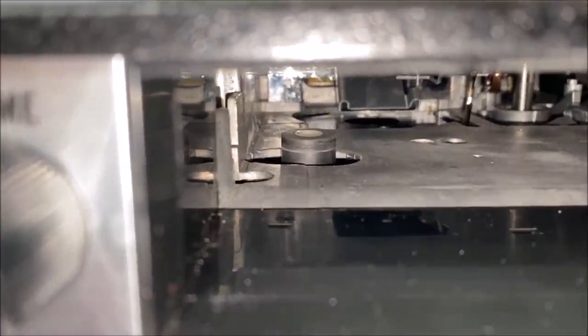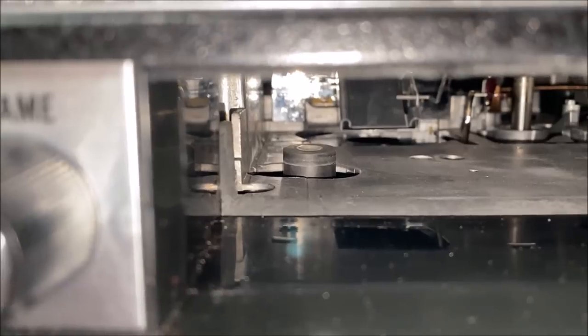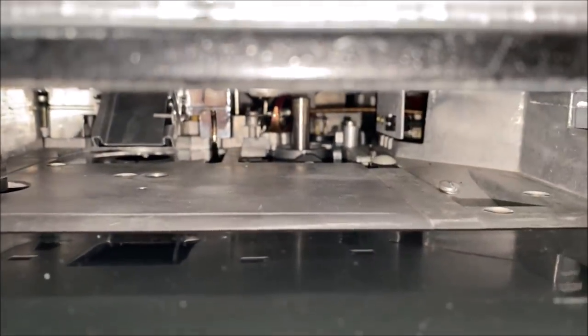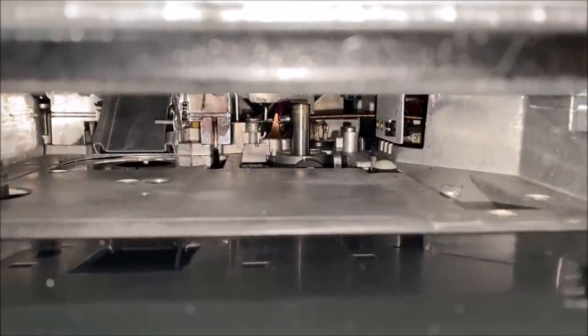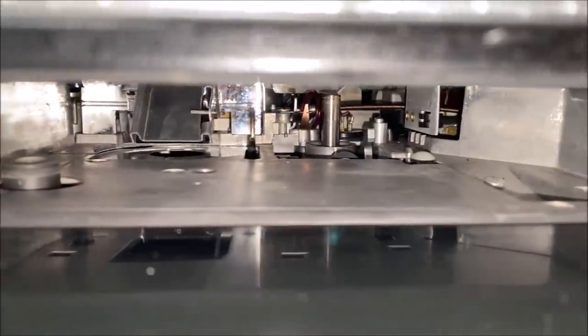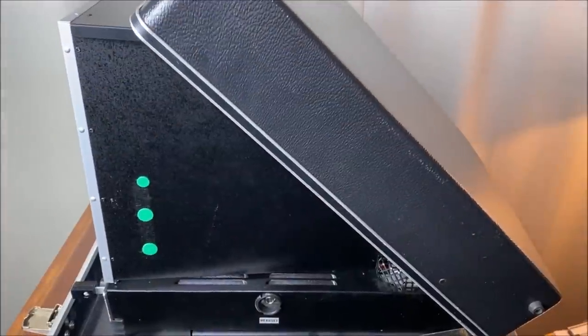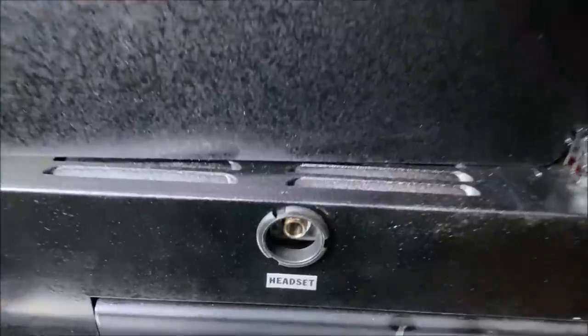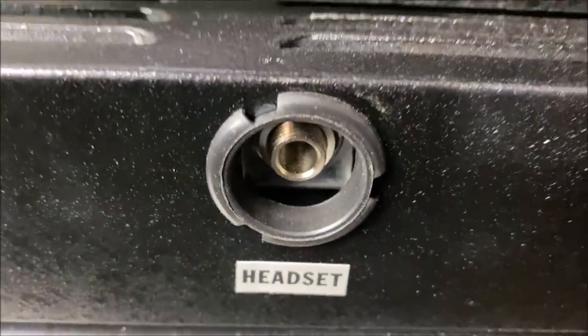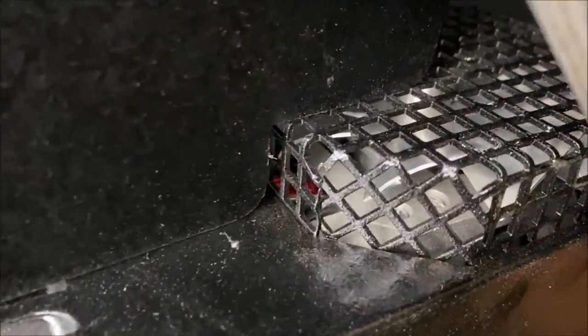There's a roller here on the left — I replaced it with an 8-track tape roller because the original one was goo. In the center you'll see the capstan that meets the pinch roller, which was fine. That little piece pops up as you insert the cassette and also brings up the playback head for playing back your content. The right side of the unit is fairly boring — it has only a headphone jack for private listening as you watch your film, and you can see the cooling fan peeking around the corner.